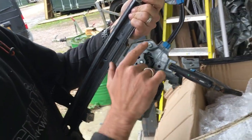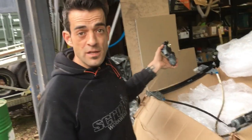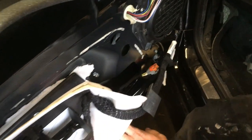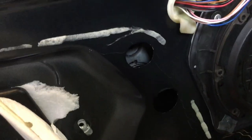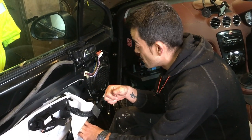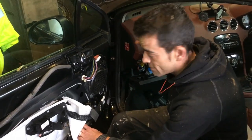What we've managed to do in the door is, from behind without seeing anything, I've managed to undo these three Torx bolts and without removing the regulator, remove just the motor. Let me show you the space we have to work with - it's just a little Torx T25. Once your door card is off you've got this space here. This motor sits behind the window regulator. It's a horrible space, but you've got to try to remove those three Torx screws blindly. Hopefully that does the trick.